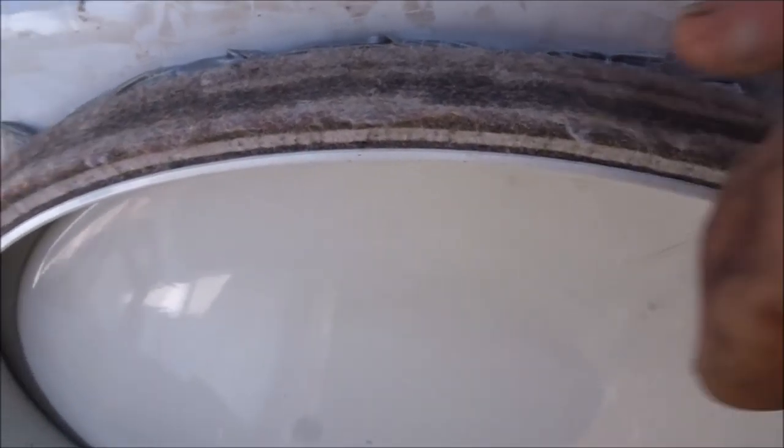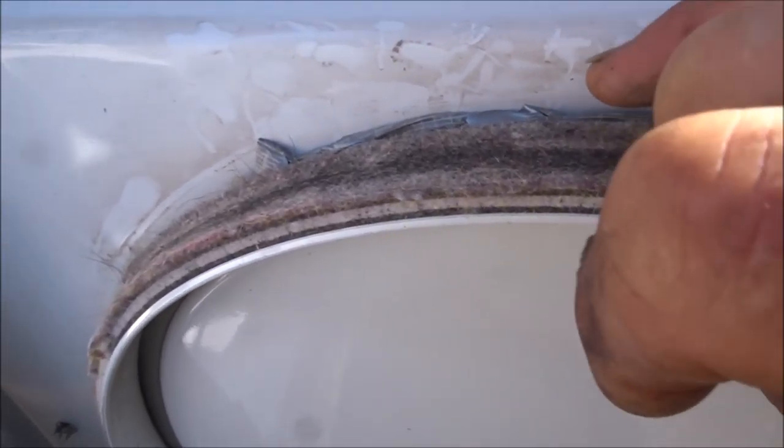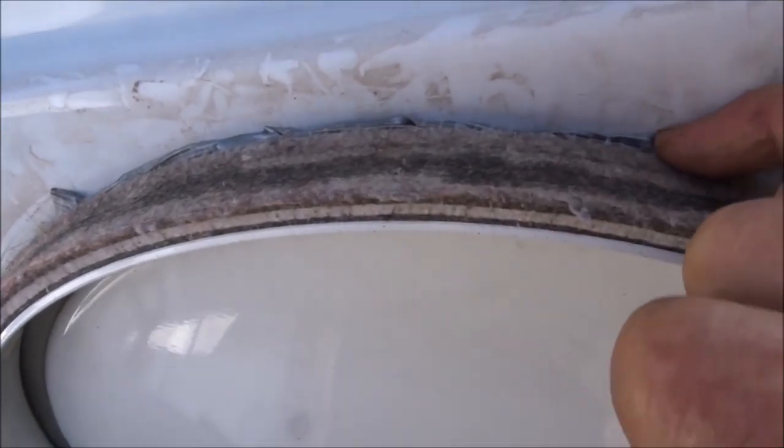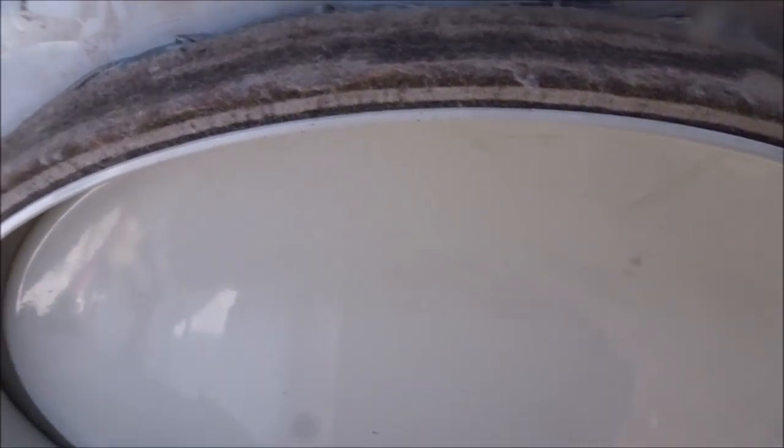Here's my technique for pushing the felt out: basically you can take some duct tape, wrap it the opposite way, and just stuff it in there so the sticky side is out. It will stick in there and push the felt bushing out all the way so that the top bushing has more to ride on.